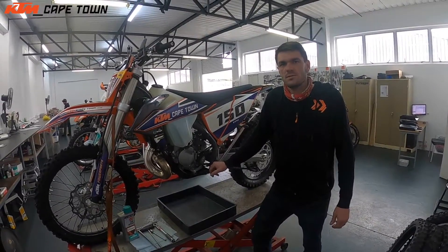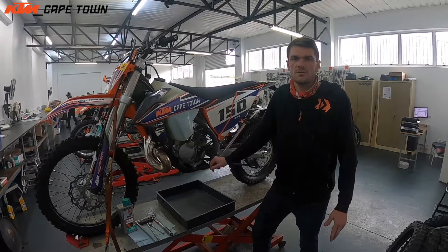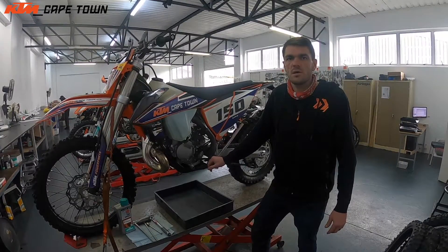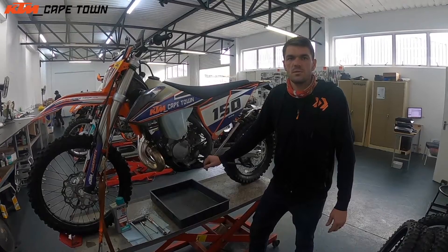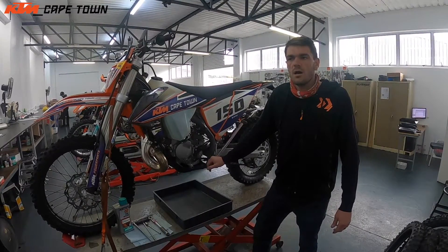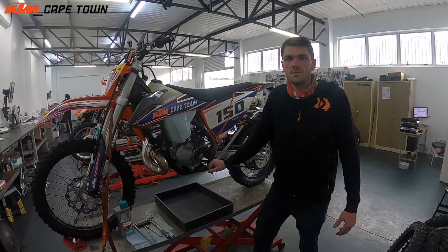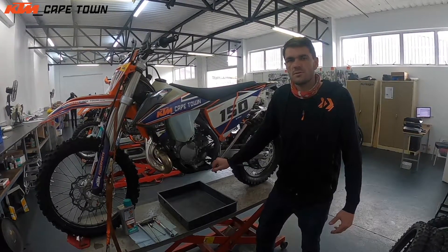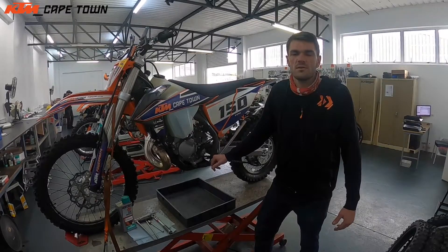Here on the left-hand side is my trusty colleague and technician John to talk you through the process. We're going to change the transmission oil on a KTM 150 TPI. The transmission oil on a two-stroke machine is there to lubricate your bearings, gears and shafts on the transmission, as well as your clutch. The clutch is the part that dirties your transmission oil — the clutch wear washes off into your oil. The manual recommends it be changed every 10 hours, but it could be more frequent depending on the amount of clutch use.